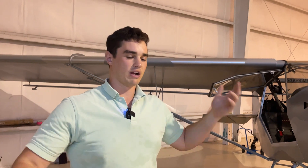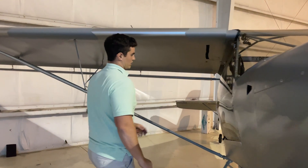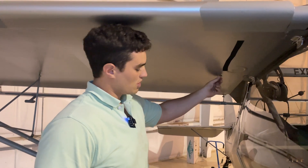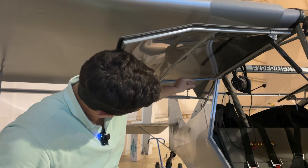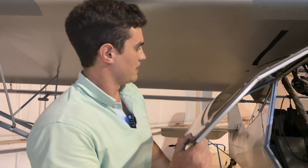I feel like it would have been a lot faster with a quick drain. With the current valve as provided in the kit, you could sit down there and depress that valve — it makes a mess and I've done it before; it took me like an hour and a half to drain the tanks. The other option is these ports on the wing — there are two of them. Some might ask why not put quick drains on this port. Well, with bubble doors it gets very close to that valve especially under wind, and if you put any extension on there it would crack your windshield every time you open the door.